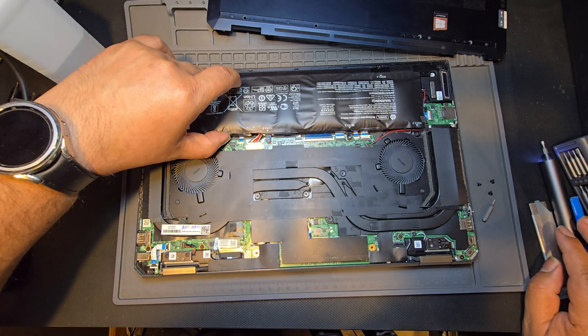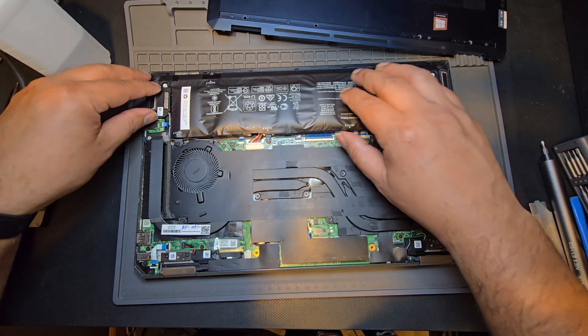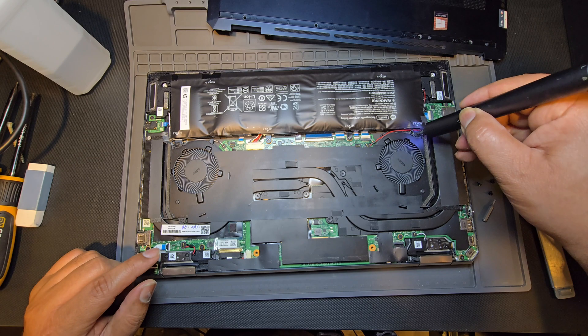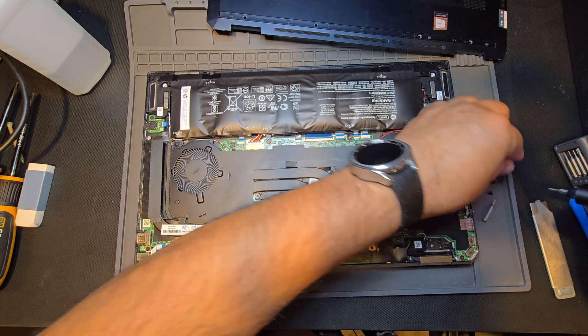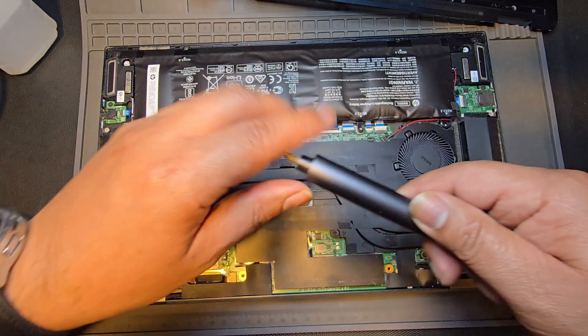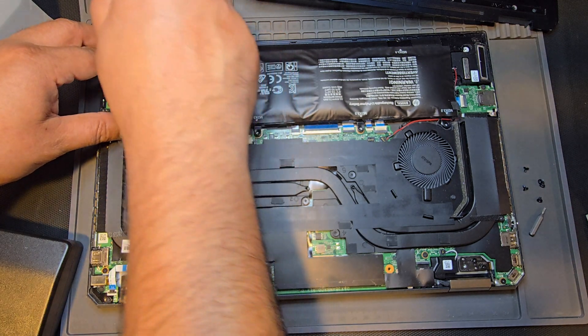Make sure there's no heat coming off of it — that's what I'm doing. We have a screw there, so this is why you pry carefully around different things. You just never know where there's going to be a screw hiding out when you're doing these repairs. Don't ever pull hard — you'll break something. We've got a few more Phillips back here.